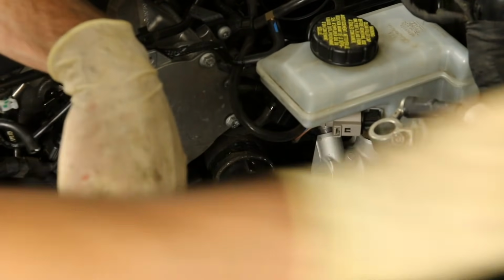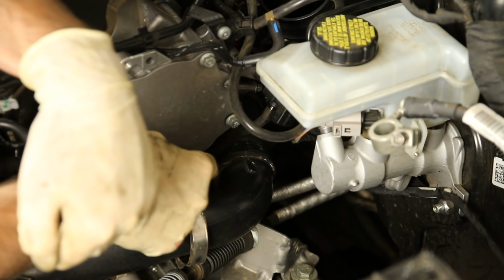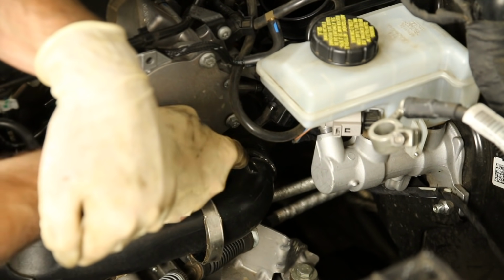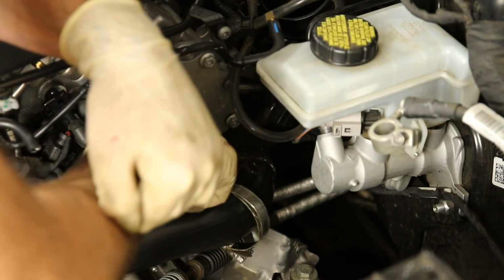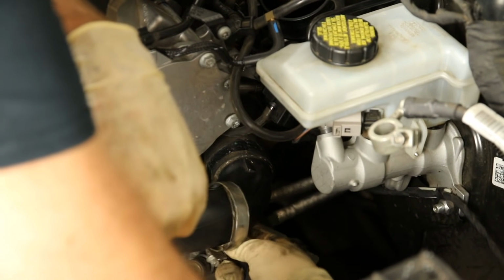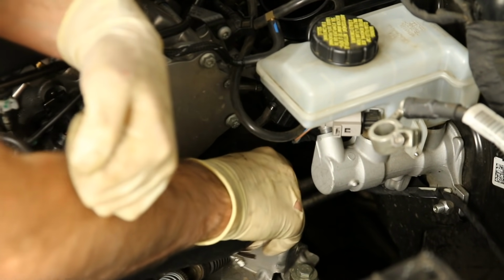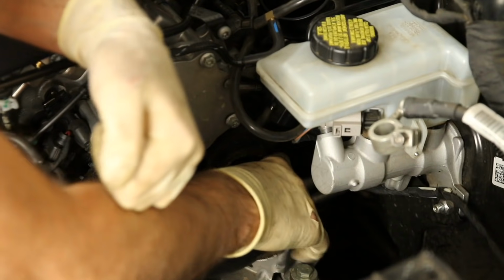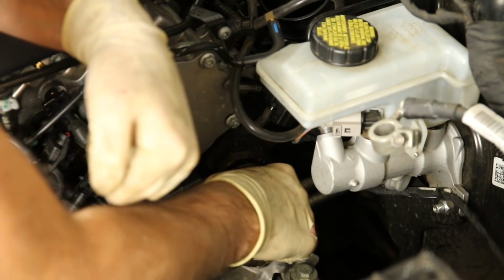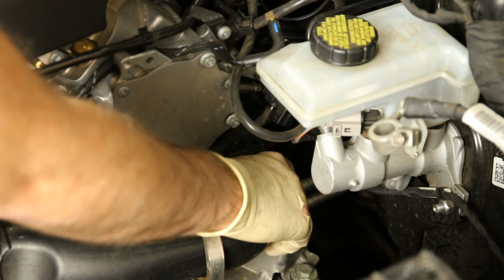And like I mentioned earlier, anytime I work with hoses, I like to pop a pick in there and run it around. Now it'll make getting this pipe off way easier, and we should be able to just run it out of there. As you can see, that has now cleared, and we are out of the coupler.